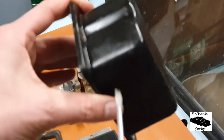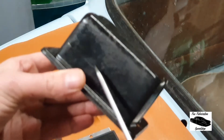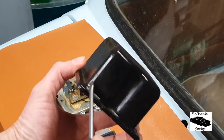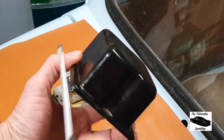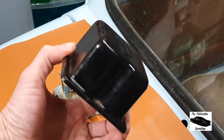What we're going to try and do today is get this cover plate to sit nicely onto here with a little bit of modification — a little bit of cut and shut, if you like — so that I can mount this in the car and have it look vaguely like the original one does, without butchering the base plate, which is what I would have done if this had been absolutely irreparable. I've measured it up, I've got some clearance issues here and there, and I'm going to give that a little slice out with an angle grinder so we should be able to get it to fit over the base plate.